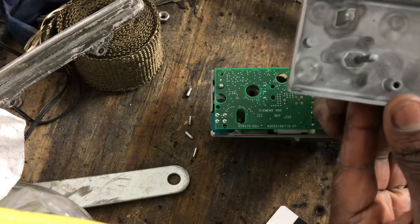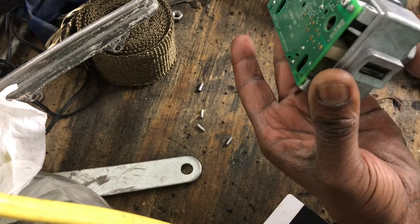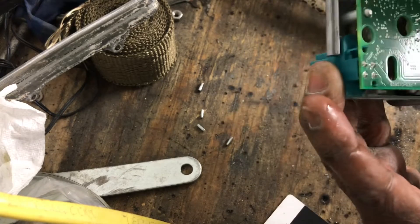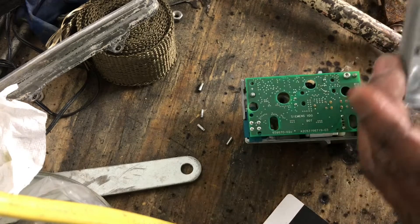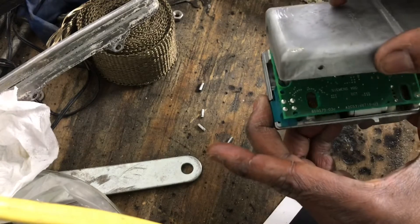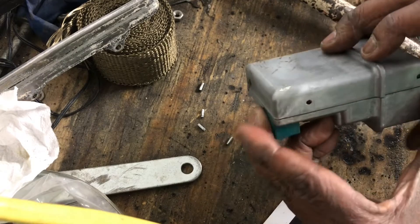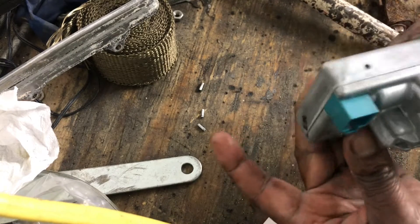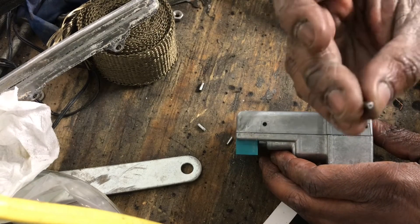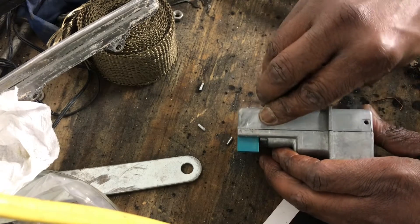You're gonna come with your cover — just like you took him off — and that spring actually pushes against our lock, and that stud just goes up in that hole guys. I'm gonna put a little grease on our stud too. Let's close him up, we're going right back together. Let's install our set screws back in there — y'all see the smooth side that we didn't spread and y'all see the side that we did spread.